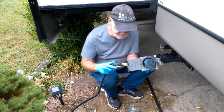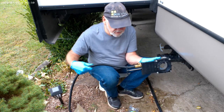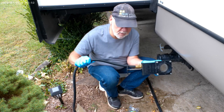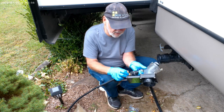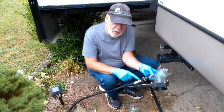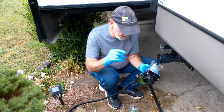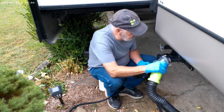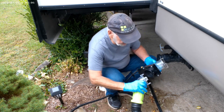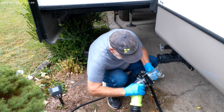Use this to hook up your hose that you would normally use to flush your black water tank. I use a flex hose here. I've got it hooked up with water already on and the water turned off. Wear your rubber gloves. Hook your sewer hose up that you normally hook up to your RV tank — put it on your flush valve.